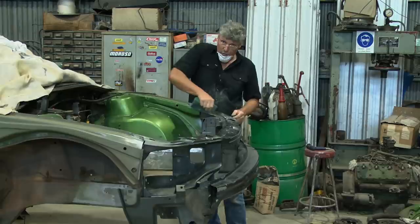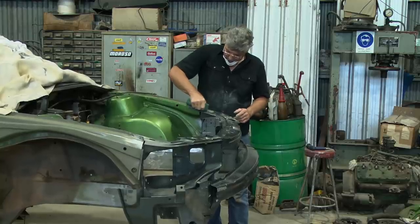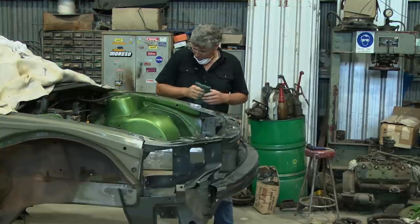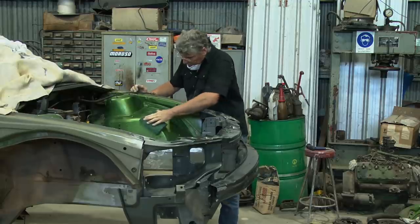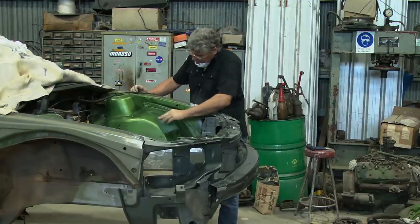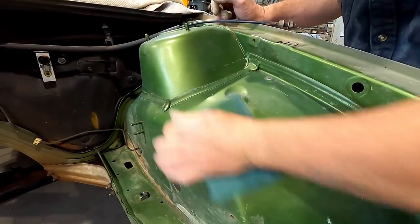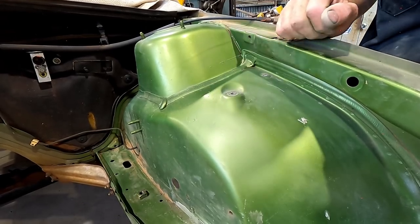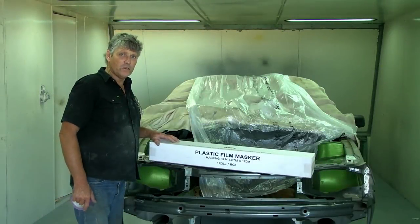If we sand it too fine at this point in time, we can have delamination. If we don't sand it enough, we could have delamination. So it's one of those things, you really need to get rid of any shine, and it's a bit tricky where you've got an engine bay situation and there isn't a lot of shine, but on these areas, we can see the scratched up surface. Close up, please. So we've got all these scratches in here, and that's what the new paint's going to actually bite into and bond onto.